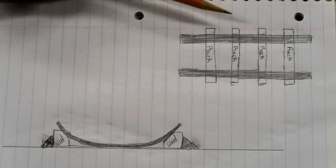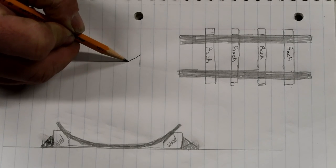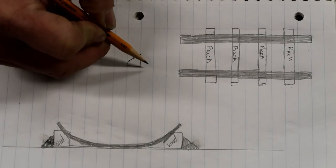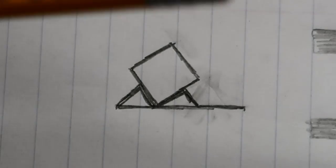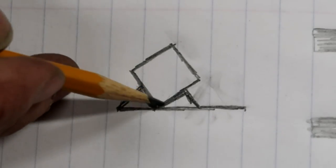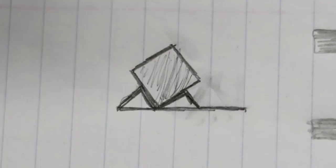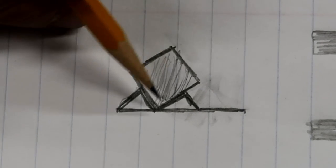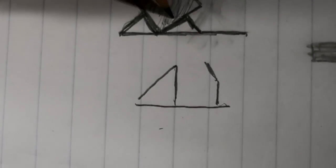Four racks will do 35,000; five racks do 40,000; six racks do 50,000. Most trucks are too heavy to haul six at 50,000 or above, but if your truck is light enough, that's the scale. Then you add your timbers to the end of the rack. Some racks have an edge where the timber slots in. Some will have two little triangular pieces welded to the end, and you lay an oak four-by-four on its edge between the two pieces of angle iron.